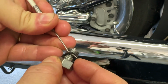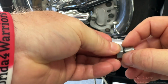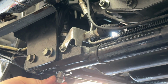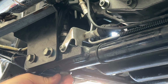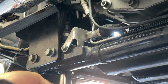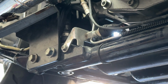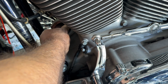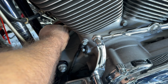During that time, I'll swap out this O-ring with one of the supplied O-rings from the kit. Clean up the last drips of oil from around the hole. And reinsert the plug. This one I don't need the hex key to reinsert because I could hold the plug while I screw it in. Just screwing it in finger tight. At which point I'll tighten it down a full seat of 14 to 21 foot-pounds. I come back now and remove that paper towel. Nothing more is coming out of here. Then checking and cleaning the mating surface, making sure there's no grime or sand or whatnot on there.